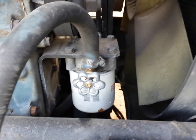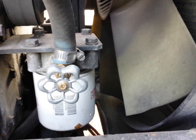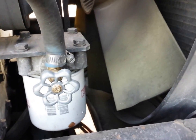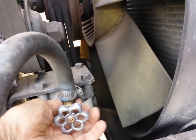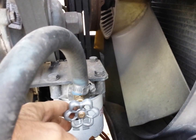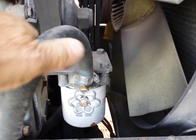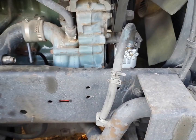While I'm at it, I'll show you the water filter. There is the antifreeze filter — it's an F2051. This valve was bad and the back valve was bad and they had to be replaced. You unscrew the filter and pinch the hose so the antifreeze won't leak out, then change out the valves. You can order them from a local Freightliner shop or major auto parts stores. First this one was leaking, then the other one — simple repair replacement.